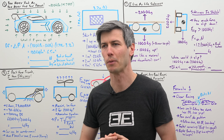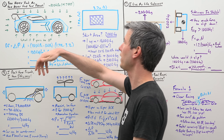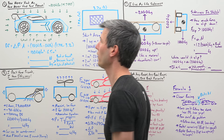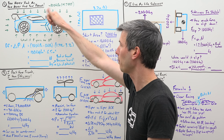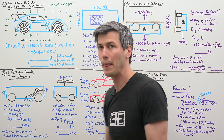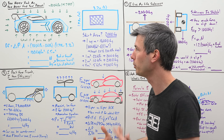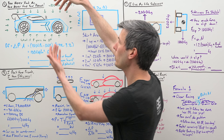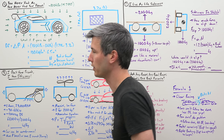So we need to understand air pressure. Air pressure is acting all around us. If you look at a car that's just sitting there, air pressure is pushing down on it, pushing up on it, pushing on the sides — so net, it's not forcing the car in any direction, whether up or down. However, if you reduce the pressure underneath the car by creating a vacuum using fans and pulling out that air from underneath the car, then suddenly you have this pressure differential between the top and the bottom and you force that car into the ground.